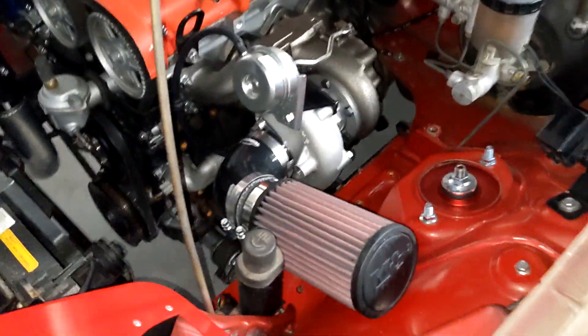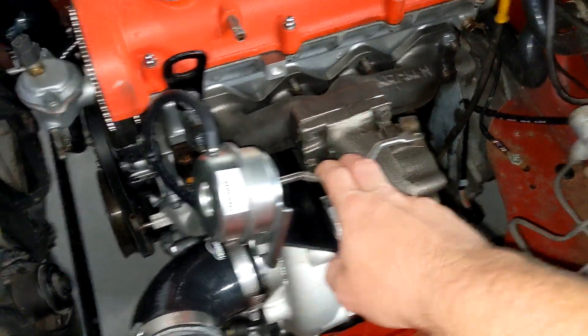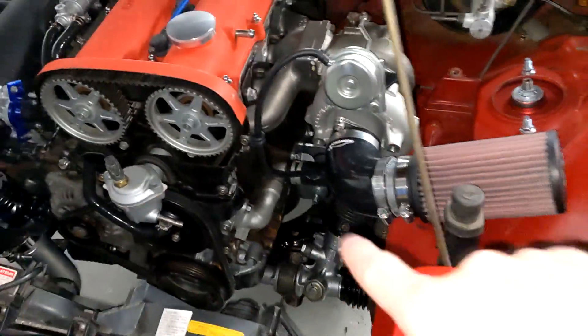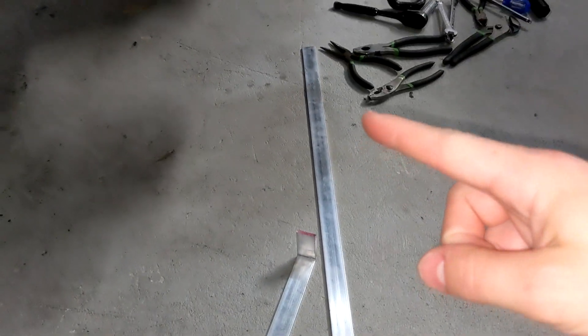It's the next day and I got a bunch of stuff mounted up. I went ahead and mounted the wastegate with the Flying Miata wastegate bracket — you can see it's all mounted up nicely. I've got my vacuum line on and I went ahead and mounted up my intake that I made real quick, just sort of messing around. Today's video was going to be on making an intercooler mount, so I went and bought some metal from Lowe's.